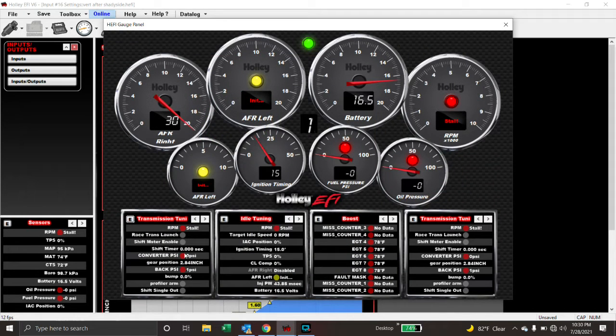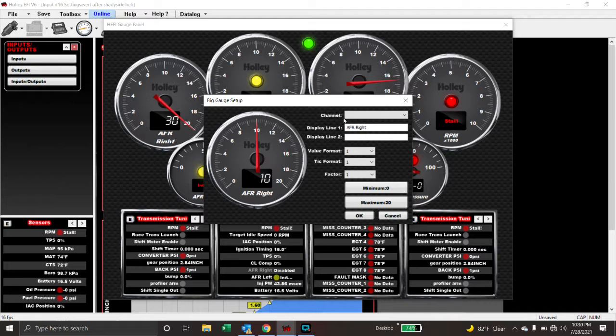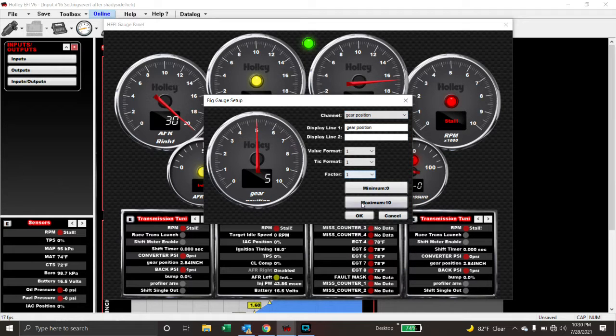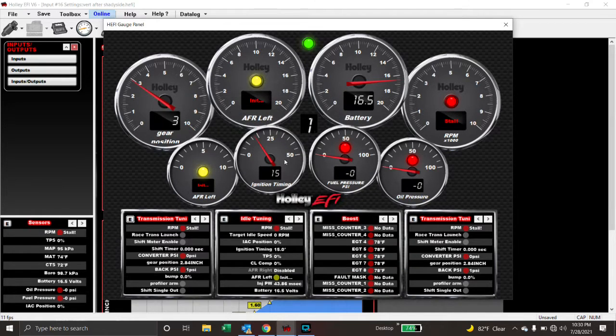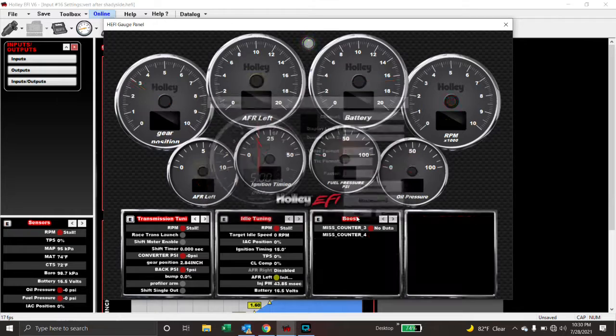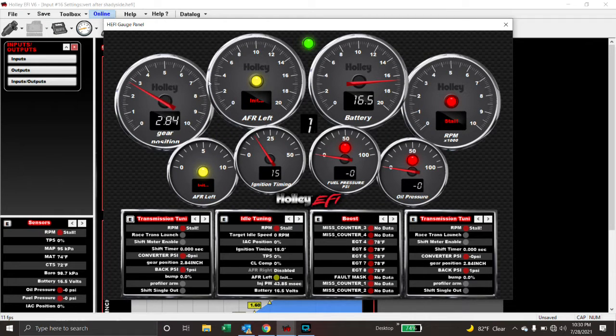So this is how I did it. I've just got my scale for inches up here versus voltage down here. Your input should already be configured if you watched my last video. We're going to toggle the gauge panel — right here where it says gear position. We're going to use a value format of 1.23 for better precision. Right now the shifter is in park and it is 2.84 volts — write that down. Then slide it into reverse: 1.89; neutral: 1.40; high gear: 0.95; low gear: 0.52.